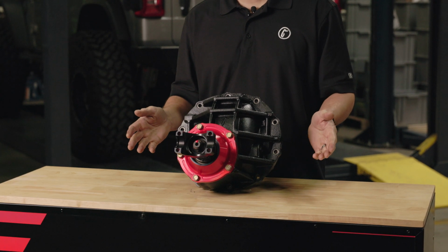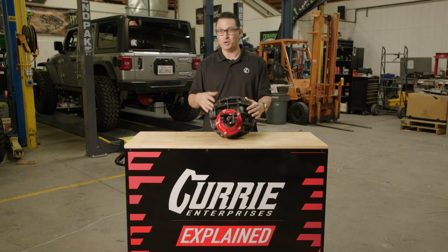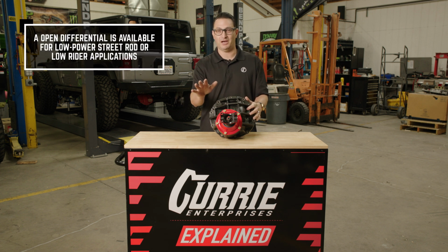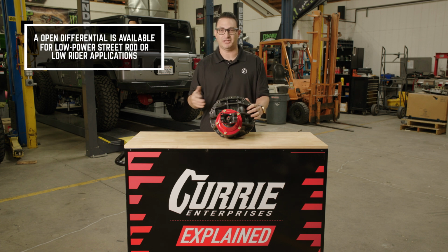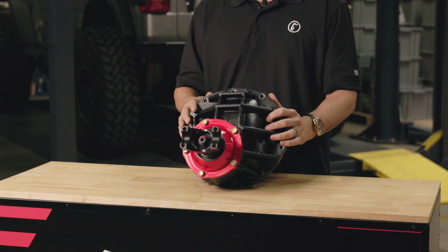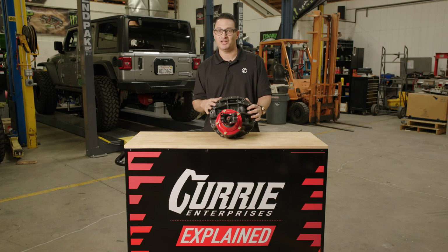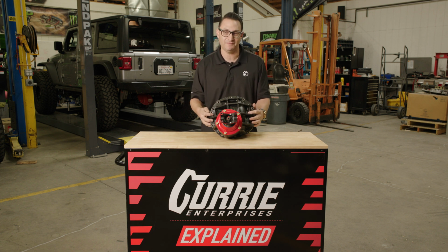Other differential choices, depending on the type of use for the vehicle, are also going to include, say, an open diff. Kind of only good application for that is going to be like a very low power street rod, but even those guys are going to benefit from running a Twin-Trac or Truetrac. But if you got an open diff, you might want that in a lowrider that does three-wheeling. You know, if you're really going to pull a front end off the ground, you really don't need posi to do that. Perfect application for an open diff.